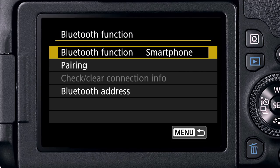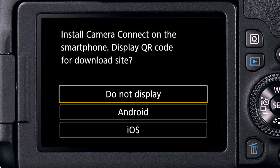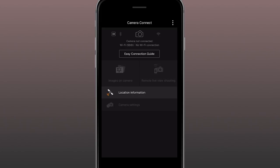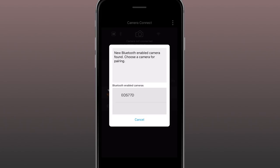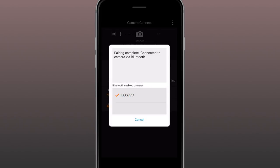Step 3: Be sure your smartphone is on. In the camera's Bluetooth menu area, select Pairing. Assuming you've already installed the Camera Connect app on your device, you can ignore the camera menu screen asking about a QR code display. Step 4: The camera menu now says Pairing in Progress — don't cancel out of this. Start the Camera Connect app on the smartphone. You should see a screen saying New Bluetooth Enabled Camera Found with the camera nickname below it. Tap on that, then tap Pair on the Bluetooth Pairing Request window that appears. Ignore any screen that pops up saying Incorrect Wi-Fi Password and click Cancel on that window.